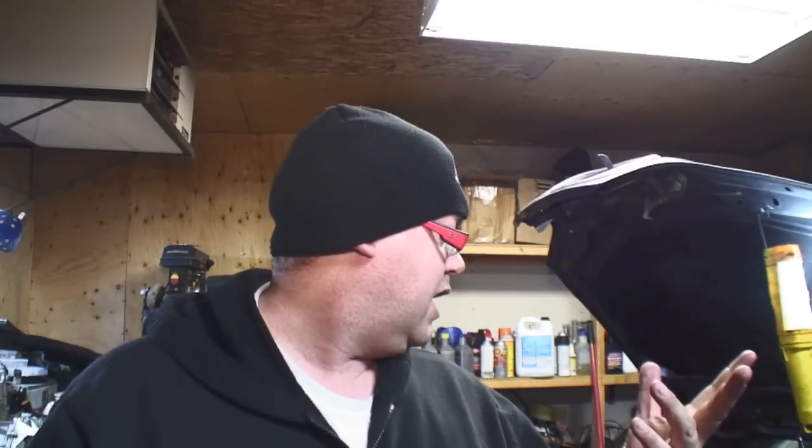So that was a short video on replacing the Disa valve gaskets. Pretty straightforward. Just remove your upper boot and your air box to make it easier. Basically remove that cover where your vacuum lines are, like that little door. Just basically what I showed you in the video. Pull it out, put it back in, 2 bolts holding it in.